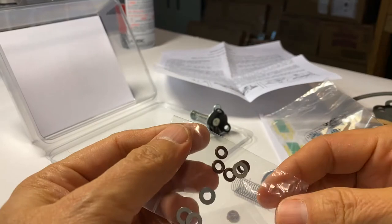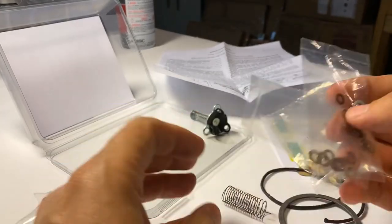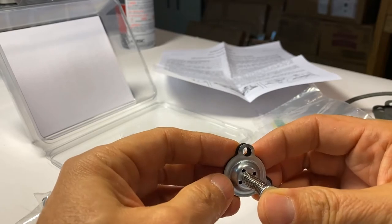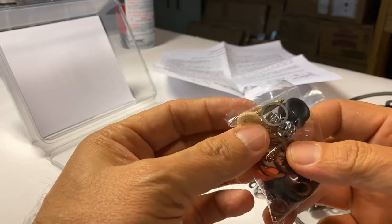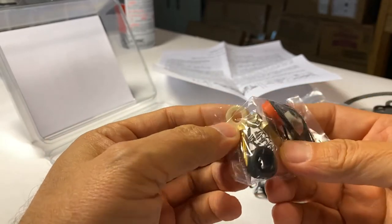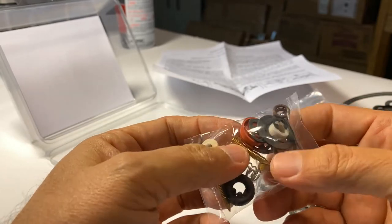I always use just a little bit of white lithium grease when putting that back together. You've got two sizes, and then you've got the one for the early size — most of these would be '54 and prior for those Holley 4000s. This is your economizer valve that screws down to the ceiling of your float bowl lid. Of course you've got a lot of small pieces. What's nice about the Daytona kit is that you've also got new idle set screws. You can see that needle there — that's going to go into the float bowl as well.